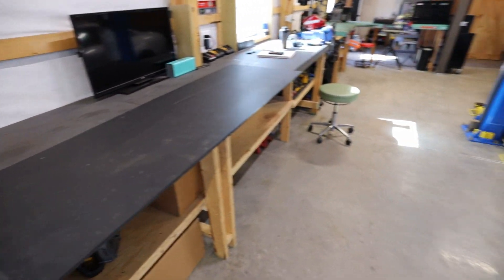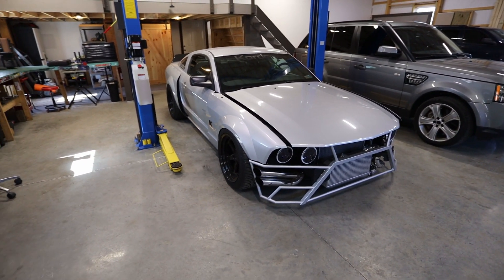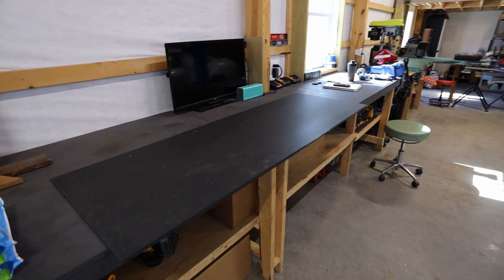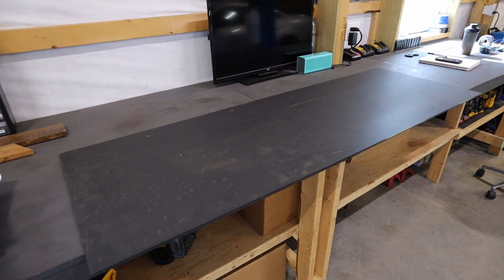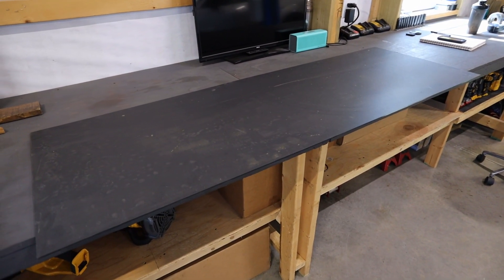I think I want to do 3 inches all around the front bumper — that looked pretty good on the Z3. I'll mark and cut it. I can always cut it smaller, but 3 inches is going to be the max I want. Once we get it fully mocked up out of the kydex, we can move to the computer and get it designed in CAD so we can have it CNC cut out of aluminum.